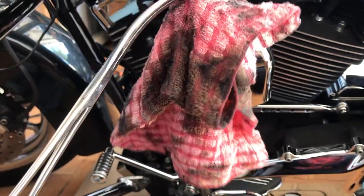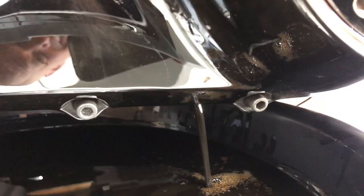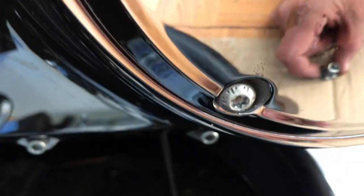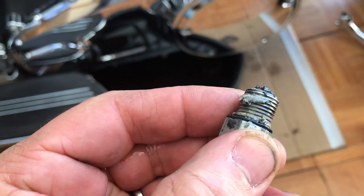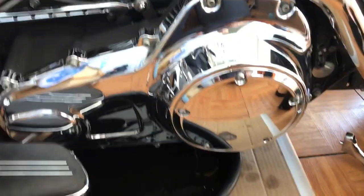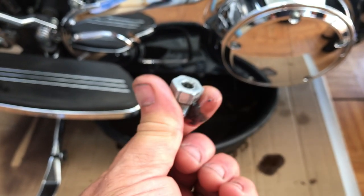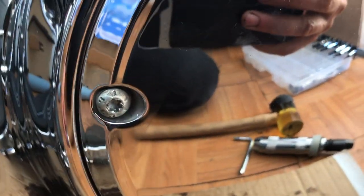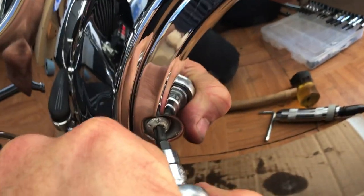Make sure you return the dish towels directly to the kitchen before your wife — or husband — notices. Now draining the primary. Again, you're gonna check for anything unusual. A little bit of metal is normal, so nothing to be super worried about. Then you're gonna drain that. This is also a five-eighths socket. You're gonna use the same specs — on this bike it's about 19 foot-pounds to put this back in. Same procedure.